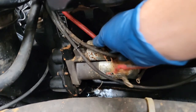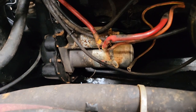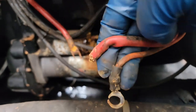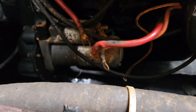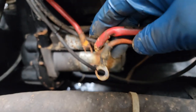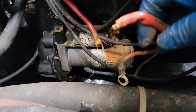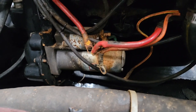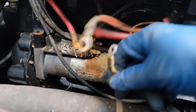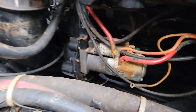Coming in to change the starter and this is the main wire — it just fell right off. It was under the boot here and as soon as I touched it the boot came right off. The main stud itself is all wiggly. These two are hot going back — this one's to the solenoid, that one's power. As soon as I touched the end it just fell right off. Like I say, on flood-salvage vehicles and boats, bikes, anything — same way on my Harley. When they're hooked up to the battery is really when it does the damage. If I would have had a kill switch in here and turned it off or unhooked the negative, it wouldn't have done that. The wire for the little cylinder at least looks good — I just had to clean it up a little with the wire wheel. So you've got to check your wiring.